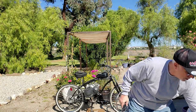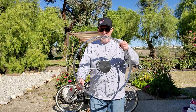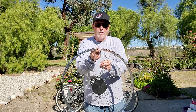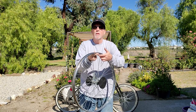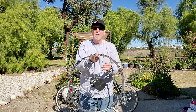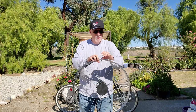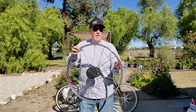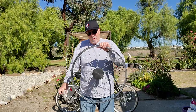So what I got off Amazon was this Flying Horse 12-gauge spoke wheel. I took it over to Canyon Bikes in Santa Clarita and the guy said he didn't know about it — the nipples want to pull through the rim and he didn't think I should use it. I said I'm sure it'll be okay. I put it on the bike, and within literally going around the block I broke like three or four spokes — or rather, they pulled out of the rim completely. The nipple pulled right through, just like the guy told me.